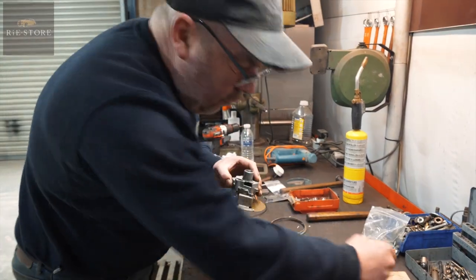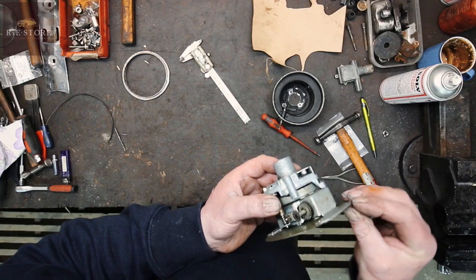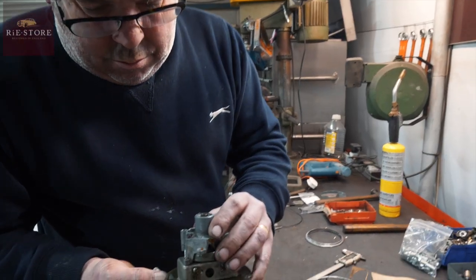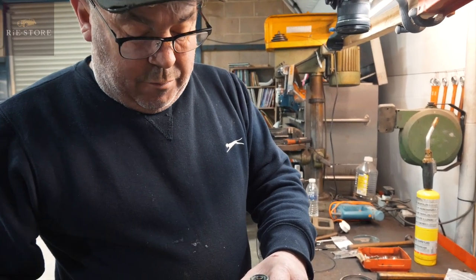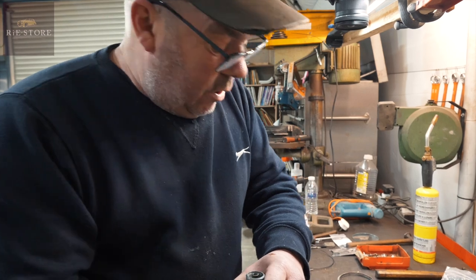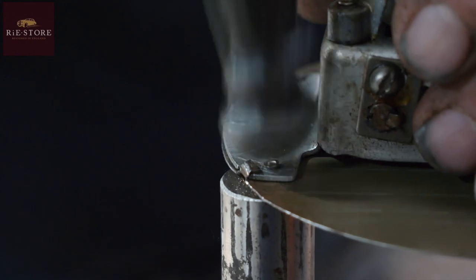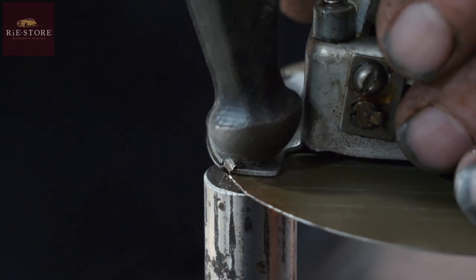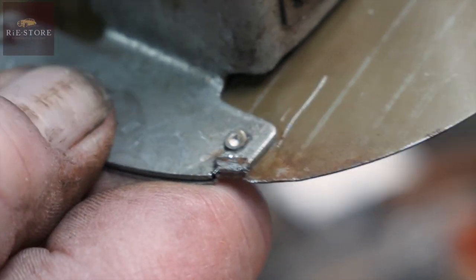It's just being careful with it and trying to hit them straight in the middle if you can - it'll just smudge them over. Being a round face, it just pushes it over more. That's why you use that particular hammer. What would happen if you used a flat head hammer? It'll still do the same thing, but it won't look as good - not that you can ever see it - but this will give you a better seal, just by hitting it straight in the middle. So that's all your rivets on nicely.